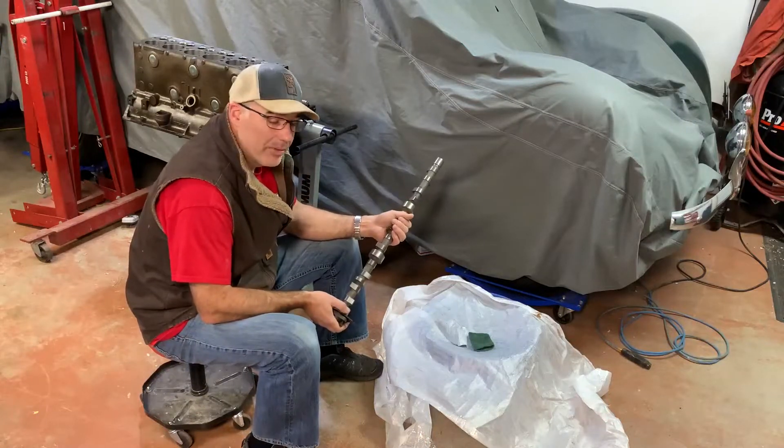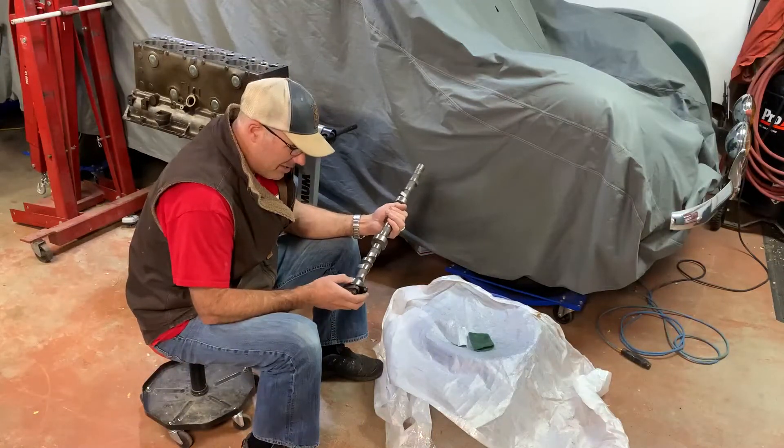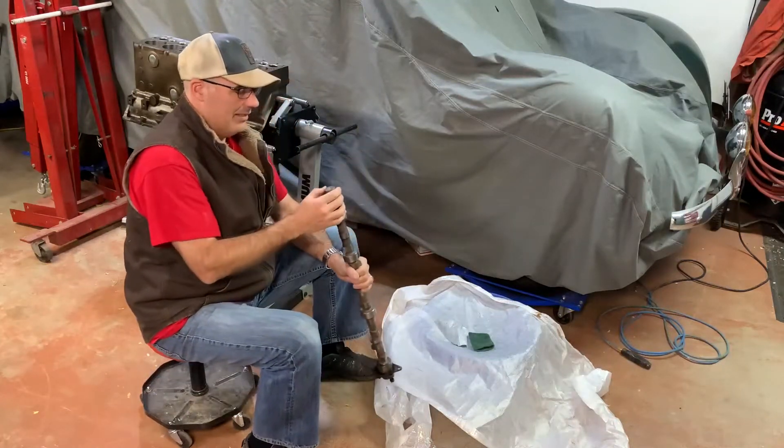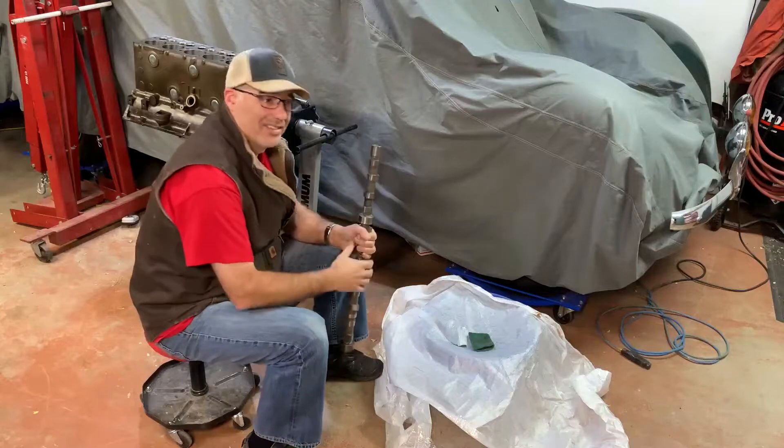Clean parts and putting a clean engine together goes a long ways in engine life, especially at first startup. Right from new, if you get that little bit of dirt or corrosion happening in your engine, it just knocks miles off your engine.